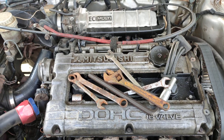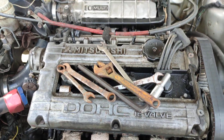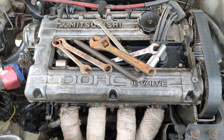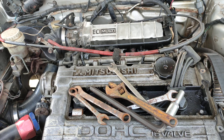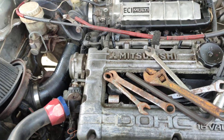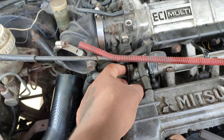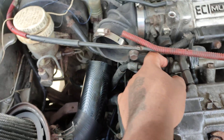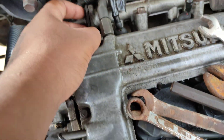I had cleaned my injectors and changed the filter first, not knowing my tank was actually dirty. So by not knowing my tank was dirty, I ended up changing those parts, cleaning it out, and flushing my tank — which ended up blocking my stuff. So what I've done now is clean my tank and already changed the filter up and the filter down.